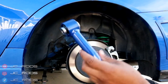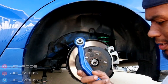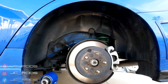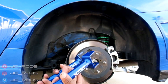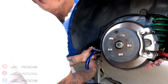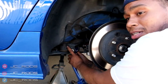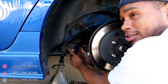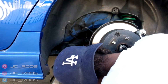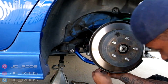Alright, fresh off the pack — there she is. I don't think these are labeled left or right, and yeah, I don't see any left or right markings. So it just bolts straight in, pretty much in the same direction. There's no need to distinguish left or right. Put the top one in first, right up in here. I'm gonna tighten it and just put the nut on the end so I can get this side on. You'll want to adjust these according to your camber because they are adjustable.